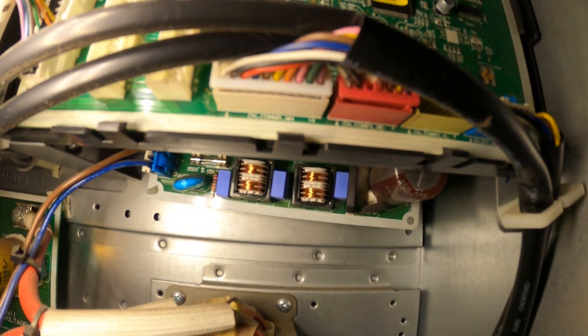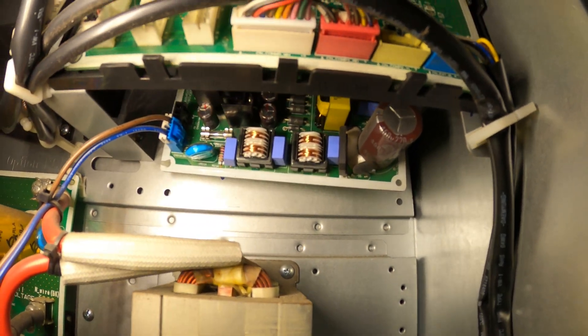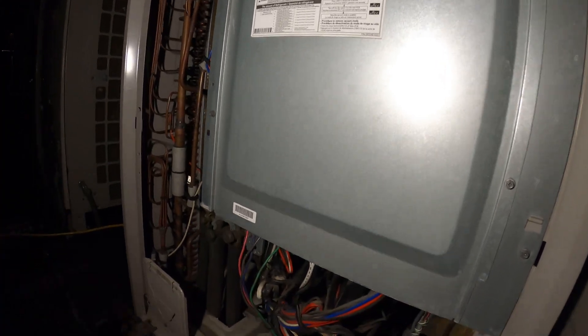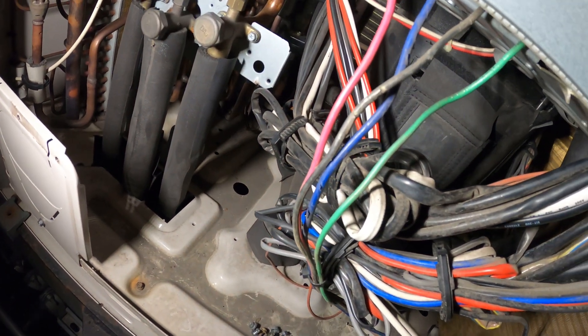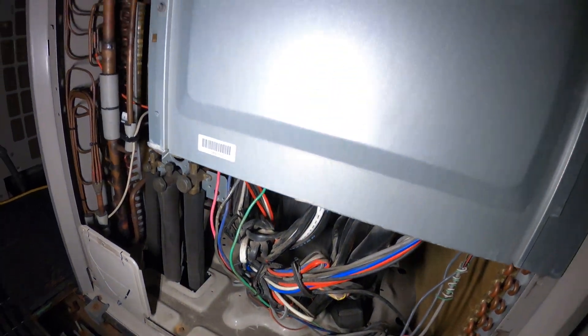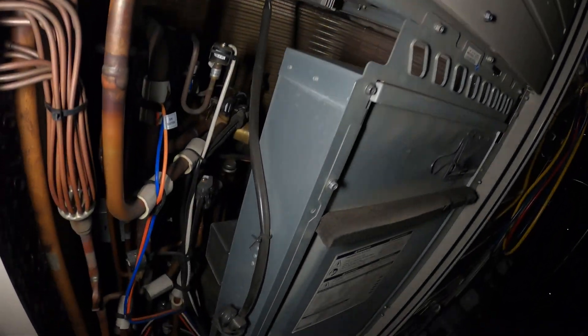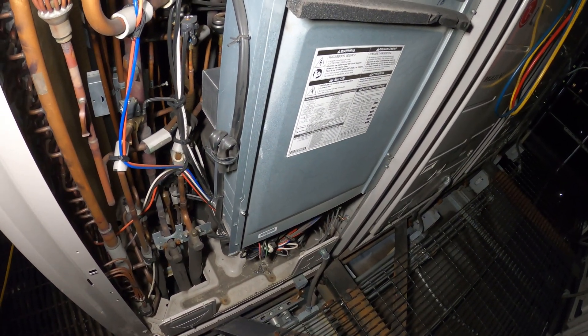Just got to put back these three wires — all set. Right here, you can see it's off the clip, a little crooked. That thing is on its way out — let's try to clip it back on. There it is, on the little clip. Put everything back, turn the power on, flick the switch. I hear the compressor trying to start — it clicks then shuts off. We got the same error, same exact error. It's that bad compressor — it's not starting. That compressor is going to have to come out.